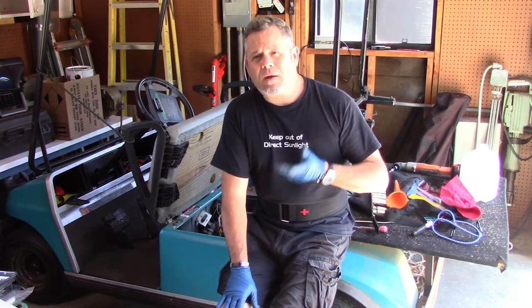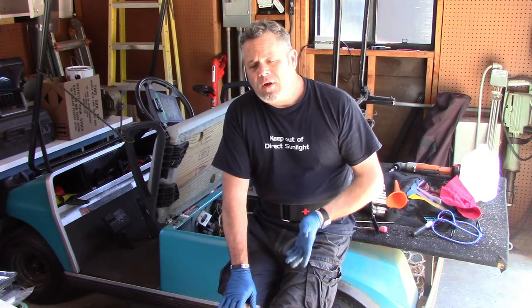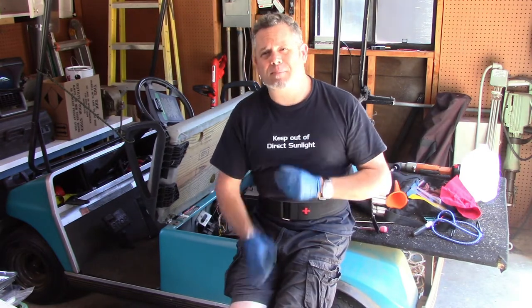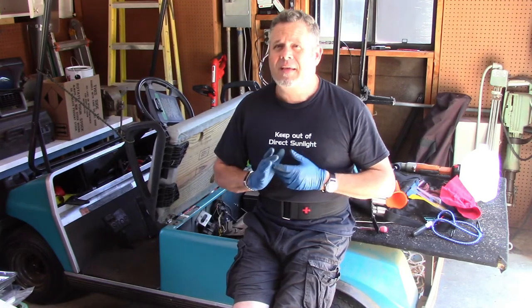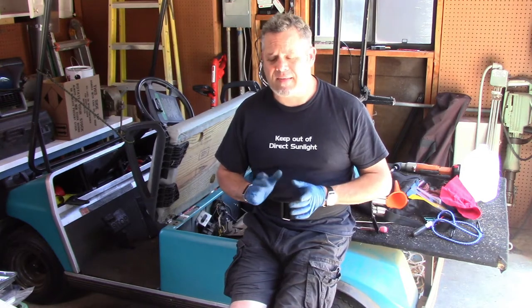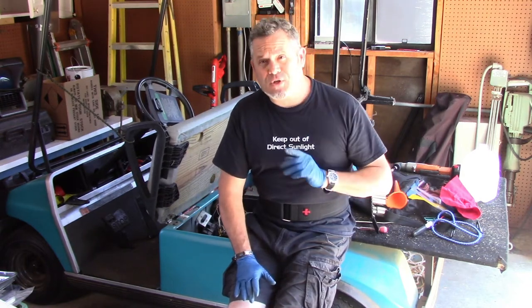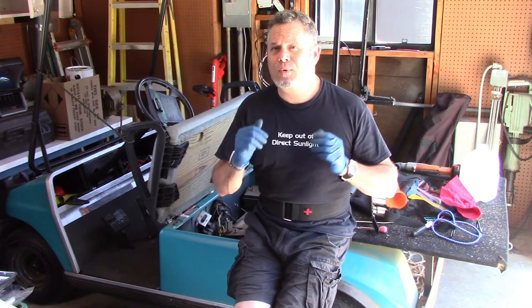And you can often, if the battery is in decent shape, put it on a charger and trickle charge it back up to 100% and it should be fine. However, batteries only take so much of that before the acid inside starts to complain. I will not go into the chemical, electrical reasons why that is. All I will say is it happens. But you can refresh your batteries. You can restore their function by adding new water to it.